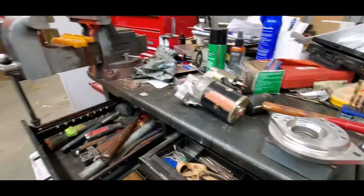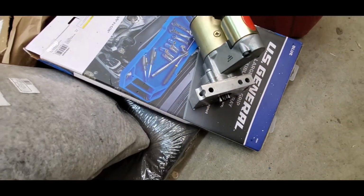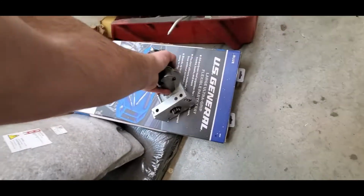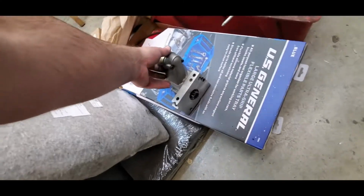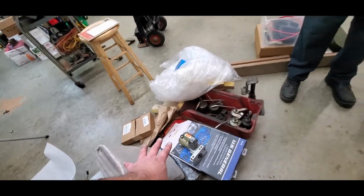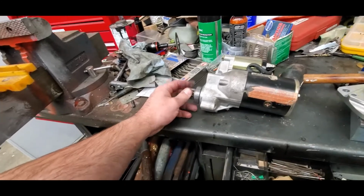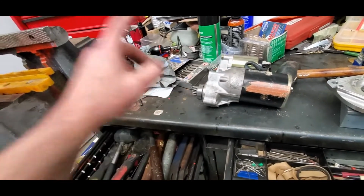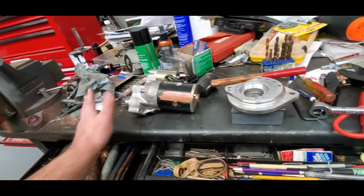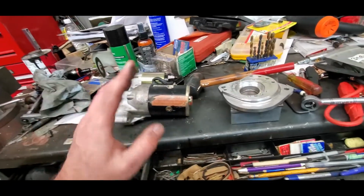At the moment, we currently have no good starters, so we were able to swap the Chevrolet interface on. Looks like perhaps upside down. Well, no, that's correct. Okay, now remember, we know that one has a weak solenoid. However, small blocks might not be an issue for that compared to this thing. Problem we're running into is to put this in the car, this plate can't be on to get this in, or we have to remove the motor. That'll be fun. So we have to be able to assemble this in car.